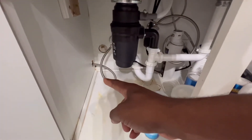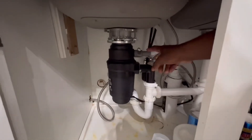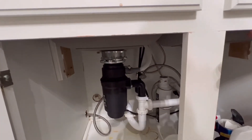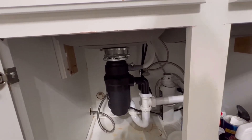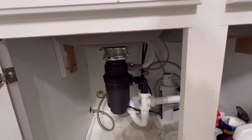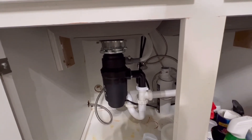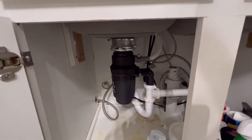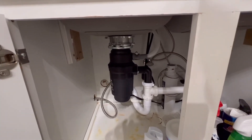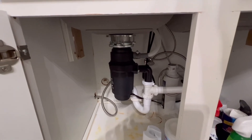Anyway, it's working now. I also rerouted this hose — at first it was coming in from a hole down there, so I re-drilled it way up higher than the outlet itself. I saw some videos saying if the hose is higher it won't push back, so I drilled a new hole at the top and looped the drain hose down. Haven't had any issues — I've run it three cycles already. Hopefully this saves somebody a headache. Happy New Year, and I'll talk to y'all later!